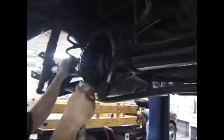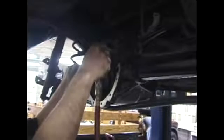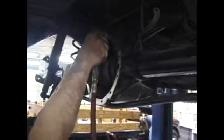Mark is using a Scotch-Brite on a side grinder to clean up the gasket surface of any of the old gasket and old sealant and any rust or goop that's on there. You need it to be clean and dry, free of any oil or anything in order for the seal properly when we put it back together.